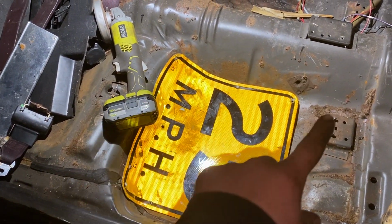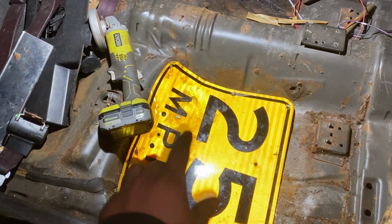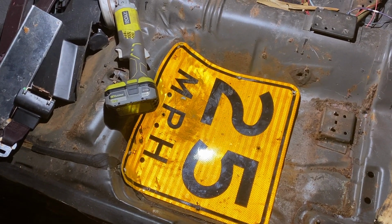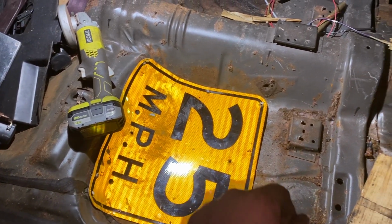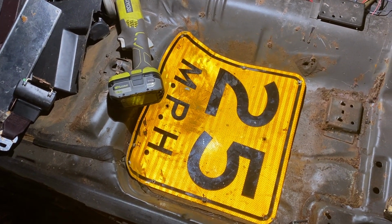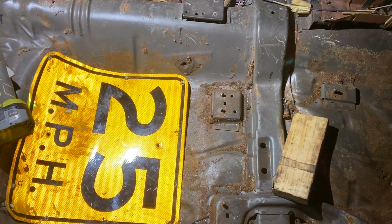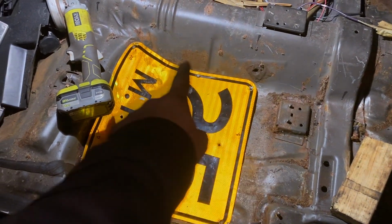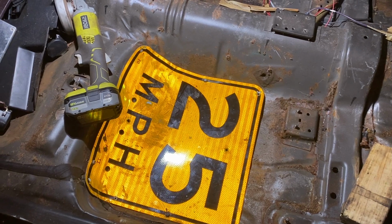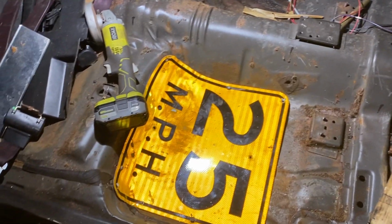We'll pull it back off, we're going to silicone the snot out of it, then place it in, and then self-tap it all in the holes that are already pre-self-tapped. Maybe stepping up to a bigger bolt size, just because they might work the holes a little bit with the sizes that I'm using now. But then after that, once our sealer is gooping up around it, we'll spread it around, make sure it's good. And then we'll probably drill a few extra holes and then pop rivet all of them just to secure it down for sure.